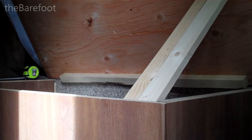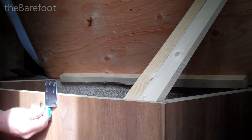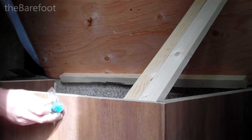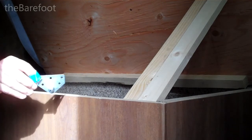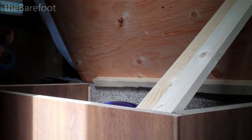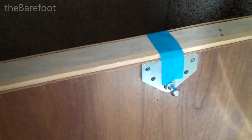16 inches is going to be right here. Mount the lower bracket — position it on the top rail base. You've got two different sized brackets: a big rectangular squarish one and a little pentagon-looking thing. These pentagon ones are the lower brackets to install down here, with this side down. This is where your painter's tape comes in handy — I've hung these with painter's tape so I have a free hand and they don't float around while I'm marking the holes.